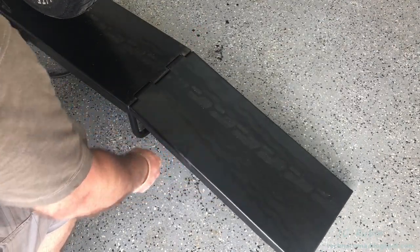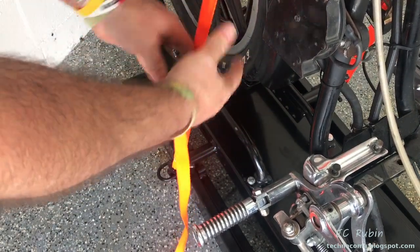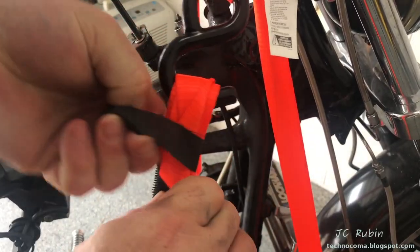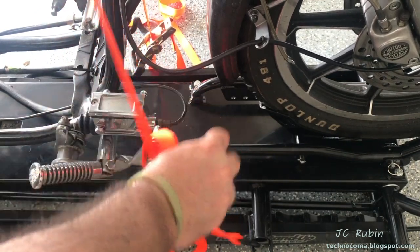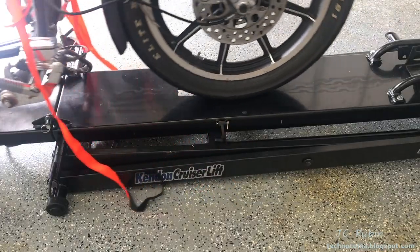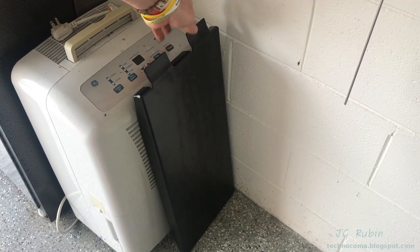Set the ramp down. Back up front, I remove the nylon straps — if you're not comfortable doing this or don't feel the bike will stand up by itself, have a second person support the bike; obviously you don't want the bike falling off the lift. With the second strap removed, we pull the wheel right out of the lock and the bike right off the lift — no problem at all. We then remove the loading ramp and stow it, remove the pump lever and stow that with the ramp.